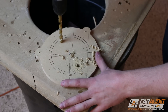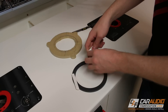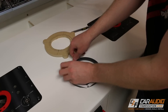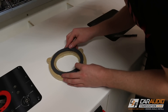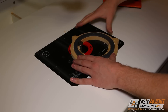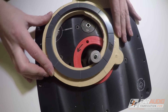With my layout complete, I'm going to drill a couple of starter holes and then use a jigsaw to rough cut this material away. Now I can take my circle template from earlier and apply multiple different pieces of template tape. Once I remove all the backing paper, I stick the template into position. It's time to fire up the router again — I'm using a flush trim bit, but I'm actually using an oversized bearing on the flush trim bit. I'm doing this so that I can slightly reduce the inside diameter and it will fit the speaker perfectly.